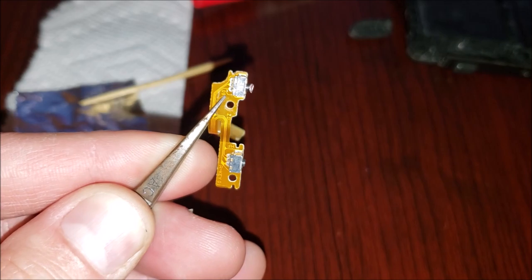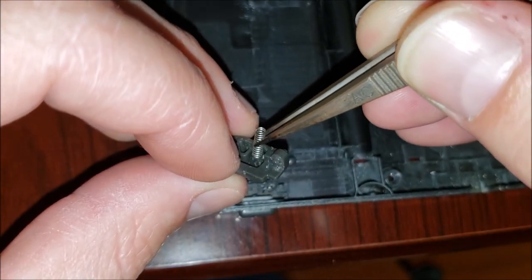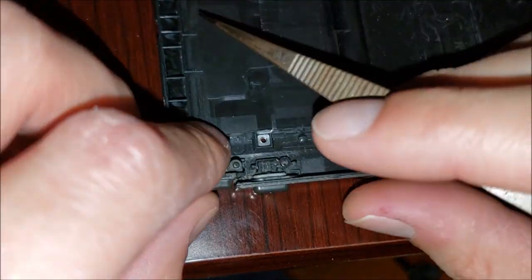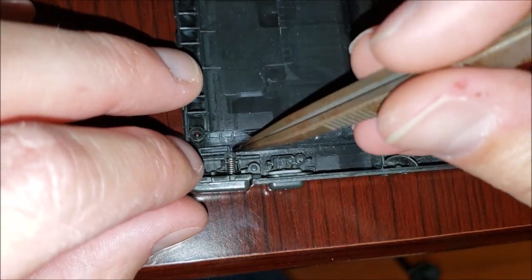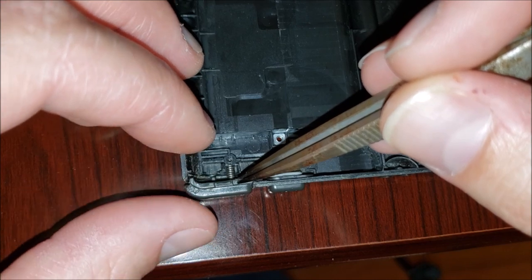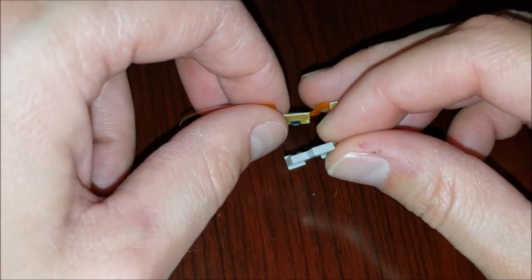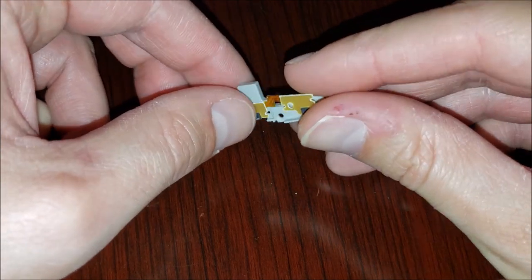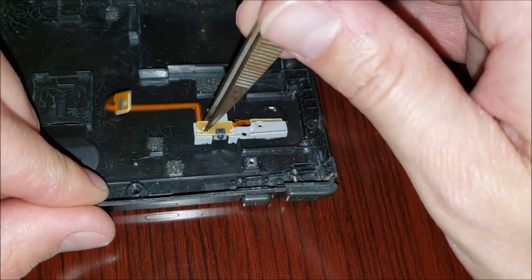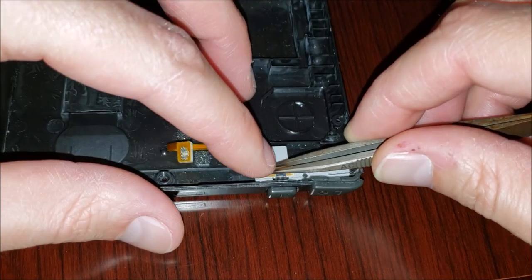Let that dry for probably just a couple minutes. The first thing to start putting this back together is put the spring back on — it just goes over this little pin, just like so. You can see there's an alignment nub right here for the pin to go in. Just set it down; see the spring sticking up, so I'll take tweezers and drop it in. You can see I have my spring action back. Repeat for the next side — make sure that membrane is pushed up, spring's in place, grab it and set it down, drop it in with tweezers to guide it.